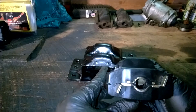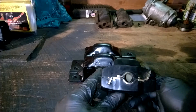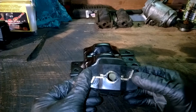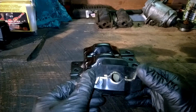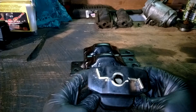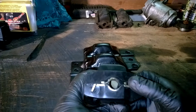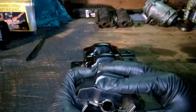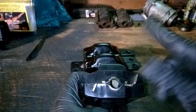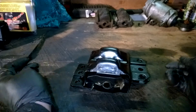Take your Energy Suspension number 3.1152G — the orientation is this way. You'll notice this tab here is a lot smaller than this one, about 5/8". You want the larger one on the right and towards the top. You can have it backwards or swapped, so just remember: 5/8" tab up and to your right, with the larger indentations on the top.